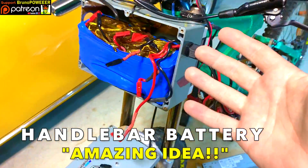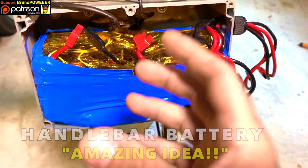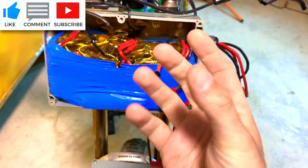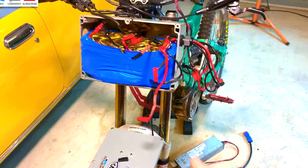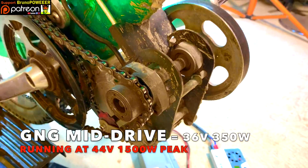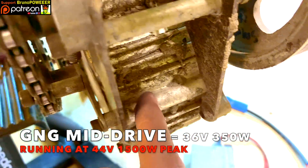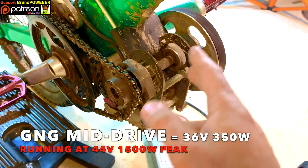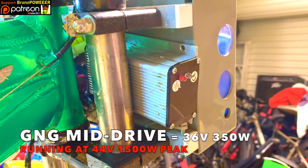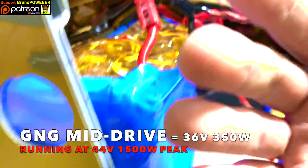Most people actually had batteries mounted inside a backpack with a little wire coming through to the motor controller and motor - that's how I did all my bikes back in the day. Some people ended up putting the battery right here, but it's a bit painful when you dismount and hit your balls on the battery every time. Some people limited the travel so the tire never hits the battery. It was a bit tricky - you needed to be creative. That was actually a very cool solution back in the day, people would be like, 'Oh my God, that's amazing!' So this is the battery - there are actually two small batteries linked in series. I'm going to explain. This is the GNG motors with a double chain setup, this is the motor here in the middle - beautiful, man. There's a reduction pulley and a 48-volt Kelly motor controller right here. Kelly 48 volts - good brand.